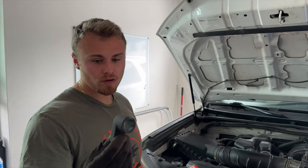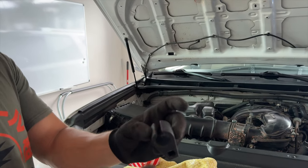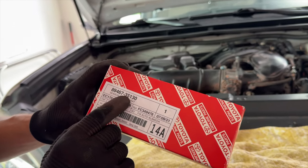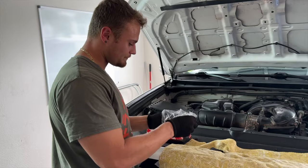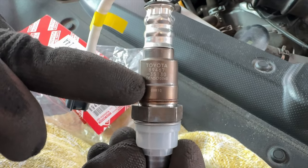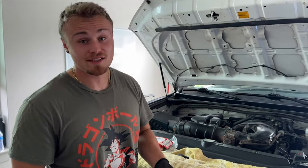You don't want to wait to replace this. You're potentially going to need some sort of heat because O2 sensors like to seize. The main tool you need is an O2 sensor socket — it's a three-eighths drive — and I'll link this in the description. This is the part we're going to be replacing. The OEM Toyota part number is 89467-35130. If you don't want to buy the expensive Toyota part — I found it on eBay for a lot cheaper than OEM — check what it says on the Toyota part: Denso is the actual manufacturer. Make sure to get it from Denso; you don't want a cheap O2 sensor that fails prematurely.